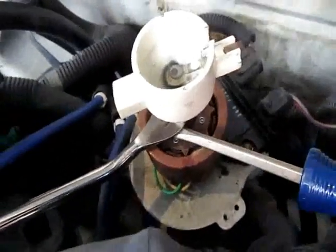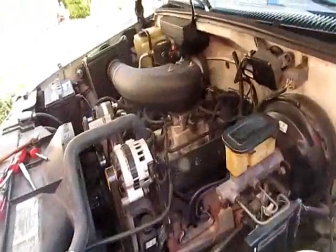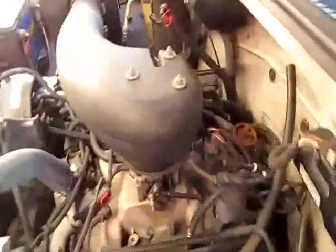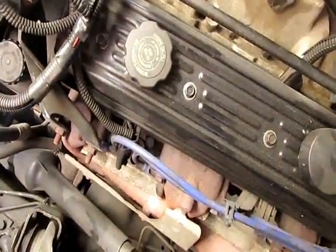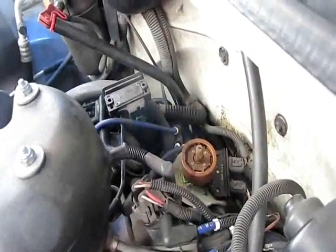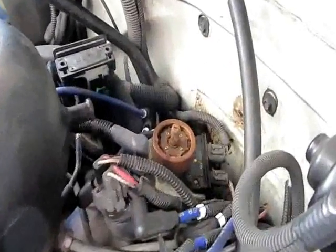You can see it a little bit. I gotta give it one more yank and I can get this thing off. So now I'll tell you what we're doing, cause we made some progress. Cap and rotor, we're changing on this thing. I don't think I'm gonna screw with the wires, but I could in theory - it's pretty easy to do wires on these trucks. That thing was stuck on. I never had a rotor stuck on so bad in the history of this rig. Look at all the rust on there.